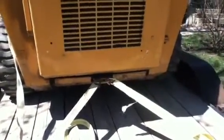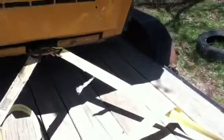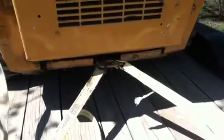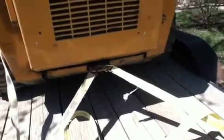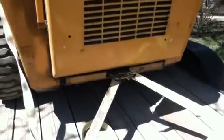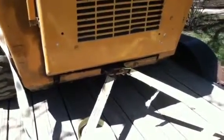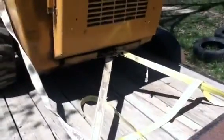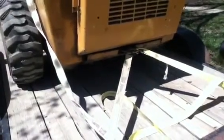You want to make sure you have plenty of straps in the back — put your better, stronger ones back there. Everybody thinks you need strength in front because of acceleration, but you're never going to take off that fast pulling a big heavy trailer. This trailer weighs a couple thousand pounds, the unit weighs 3,000–4,000 pounds. If you ever hit somebody head-on or slam on your brakes, you're going to stop a lot quicker — you don't want the skid steer or whatever load going flying forward.